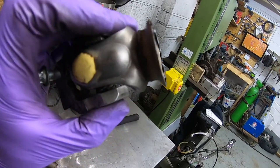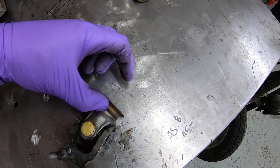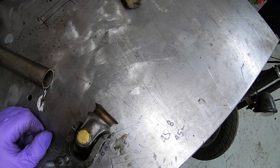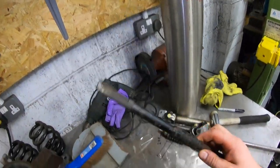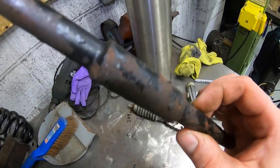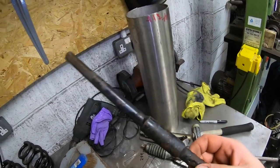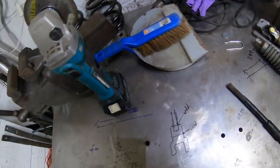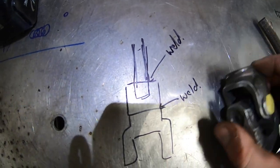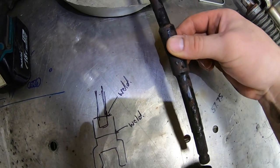How am I going to do this? I'm going to neatly cut off this lip, then I'm going to machine a solid part, and then somehow, okay, so I went and found my Toyota. So this is Toyota side, this was Ford side, and then this is well beyond me even owning a welder. Someone machined me up this converter, put the two sides in and TIG welded it up, so that worked a treat. So I'm thinking, do I either use a bit of that like 30mm steel I've got, lathe up a bung, weld it to that, bore a hole, and then weld that in to that?